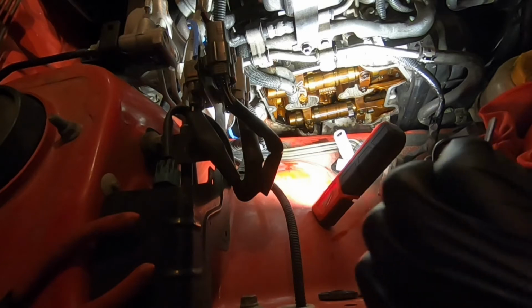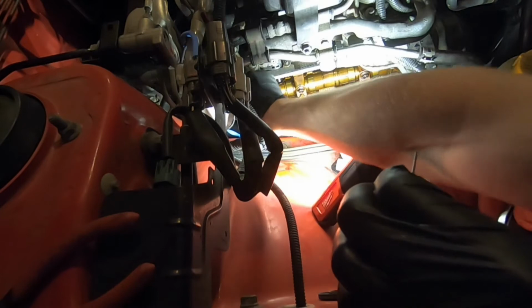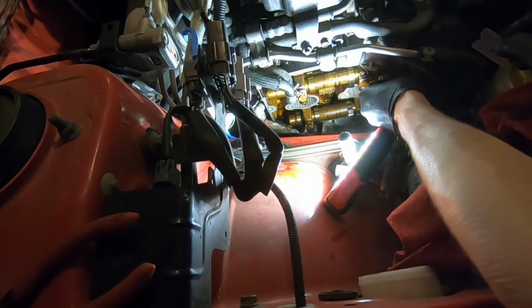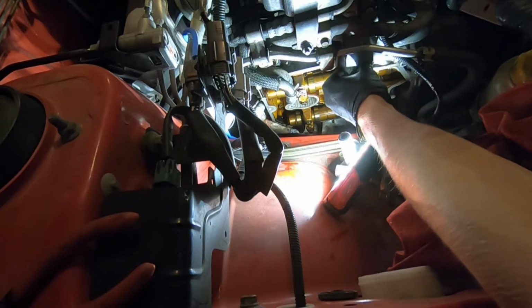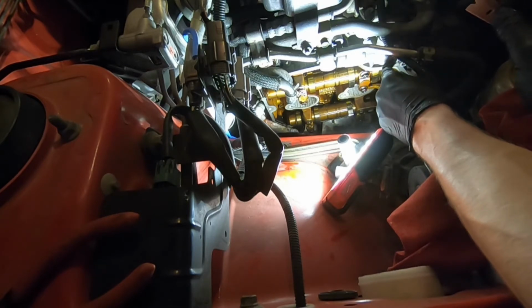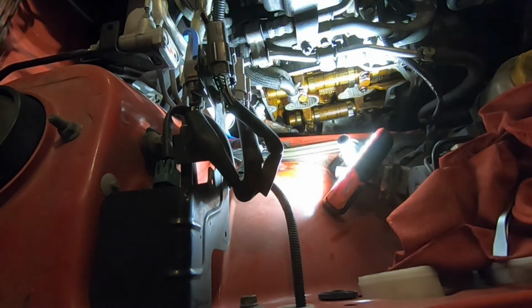So then once you have that valve cover out of there, you're just going to want to make sure you go through, check all of your areas that had sealant on it. Make sure you take all of that old sealant off. All this is coming off pretty easy. If you do, for whatever reason, have a stubborn spot, you can use a razor blade. Just be very careful not to scratch the surface. Make sure you're going parallel to that seal. Of course, we'll want to go through with a rag and some brake clean. Just to get, especially at the bottom there, make sure that all the oil is off. Got these half moons on here. There's one.